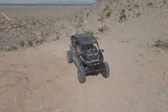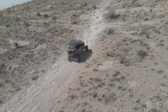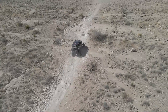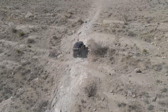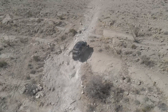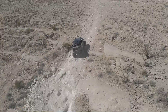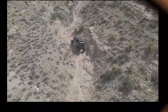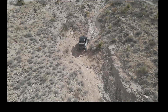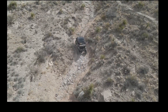I was already starting to see some rubbing on the XL fender flares that the XPs come with. So I took a heat gun and kind of pushed that in in some places, changed the profile of the plastic, and it seemed to work pretty good. I really didn't have that much rubbing. However, there is still just a little bit when I'm turned all the way to one side or the other and it bumps a little on the fender flares. As I was driving up this crevice I didn't rub one time, which I was pretty happy about.